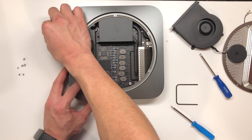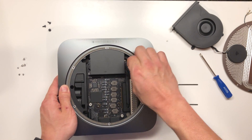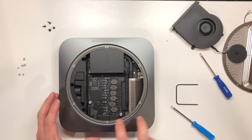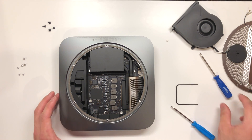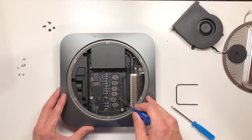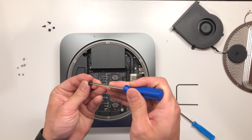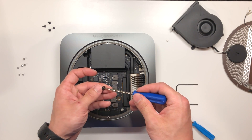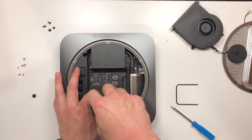Those fan screws — I have them here. Now it looks like the logic board is secured into place with these rather large Torx screws. I believe these are a T10. With my screwdriver kit, it looks like a T10 will take these screws out. However, you do still have a little wiggle room, so maybe that is a special screwdriver, but I will confirm in the description. It does look like a T10 will definitely work.